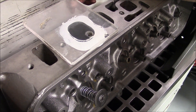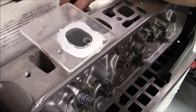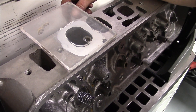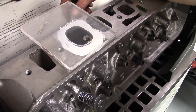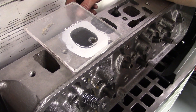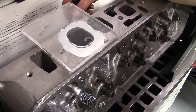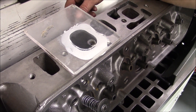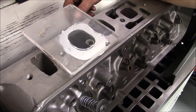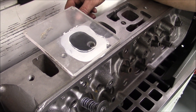To review: the good port poured 250 and a half CCs, the bad port poured 252 CCs, on the exhaust side we had 109 CCs, and the combustion chamber came in at 119 even. Those are pretty good numbers to go by on a factory unmolested head.